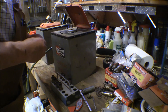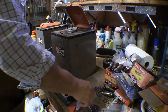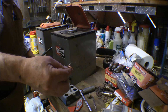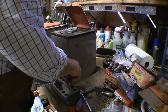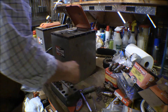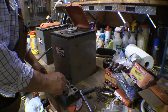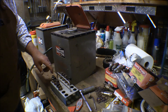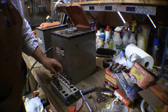What I do with those copper gaskets is anneal them — heat them up red hot and then quench them. That softens them back up again so that they'll seal again, so they're reusable. That should be done every time because they get hot, get hard, and don't seal properly. They also make a positive electrical engagement between the cylinder head and the spark plug.